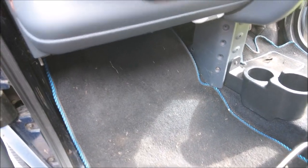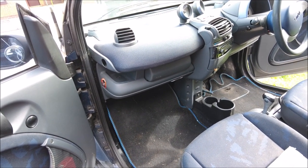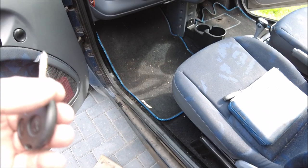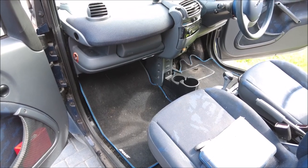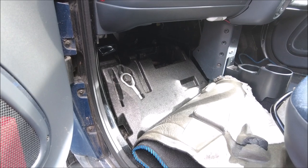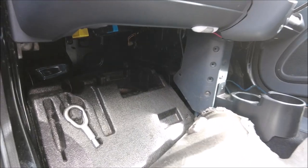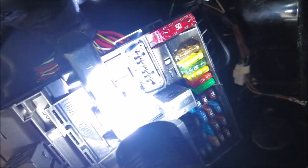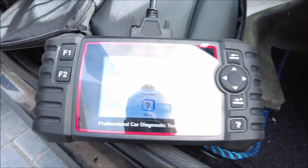Next problem — at the moment the key fobs are not doing anything. I've checked the batteries in both and had a look inside — we're getting absolutely nothing. The first job was obviously to replace the battery to get that up and running but that didn't make it good. I've got to figure out what's going on — I think the first thing is to plug in the scanner. After playing hunt the OBD port, because Smart seems to like to put them in all sorts of different places on different models and years, we're now plugged in. Let's see what we've got.